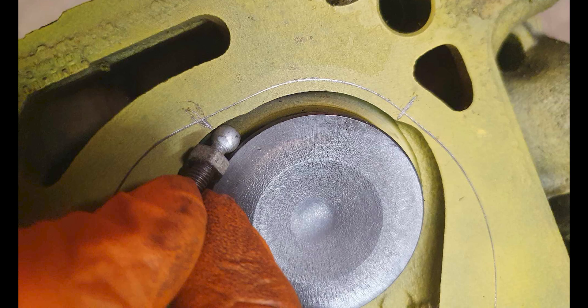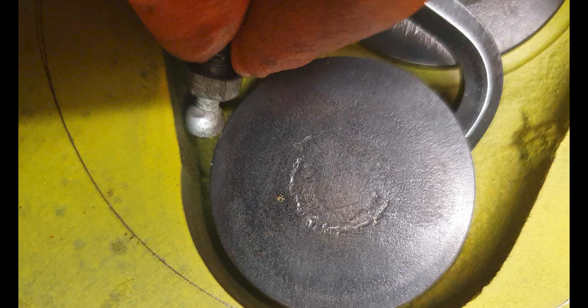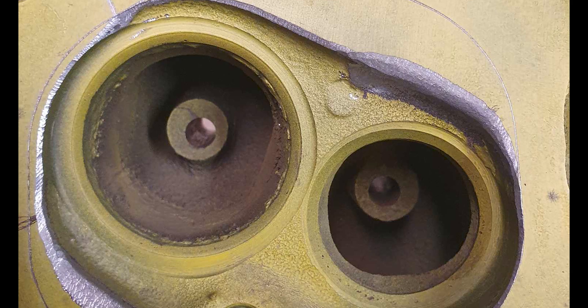You can see here where Craig has determined the two points of reference where the shrouding needs to take place. It's these points of reference around the combustion chamber that you're trying to determine where de-shrouding has to be done. This pic shows just how bad the shrouding is on the exhaust valve — we can't properly fix this and wouldn't spend the time trying, otherwise it turns into a very long process. We're going to do the quick stuff we can do within the limitations of the factory head design. This is just showing the limitations of what we can and can't do in these factory combustion chambers.